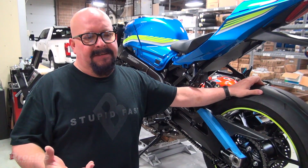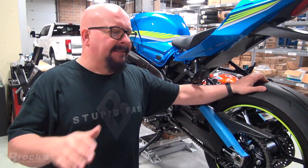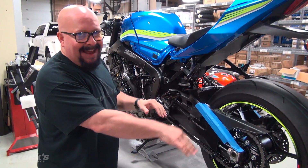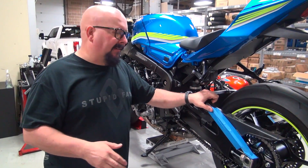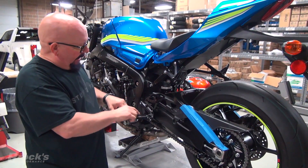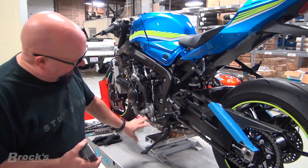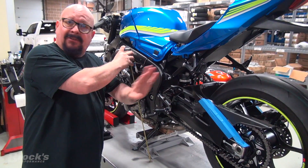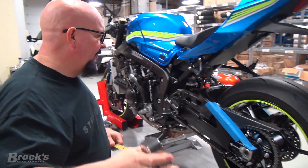Standard bikes - for instance, a long time ago when I raced my Bandit - the standard bikes and most Harleys don't have nearly as aggressive a swing arm attack angle as modern sport bikes. Today's sport bikes, the angle of attack just keeps getting greater and greater because they keep raising the swing arm pivot. On a bike like this and on a BMW, there's around 4 inches of difference - which is huge. In the past you didn't get anything close to that. We've got 16.5 and 12.5, so that's about 4 inches.